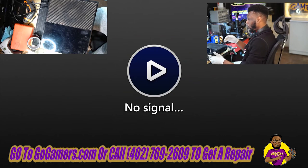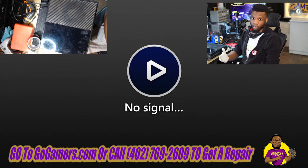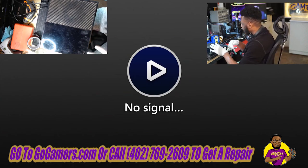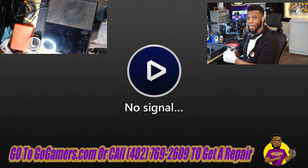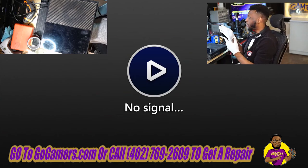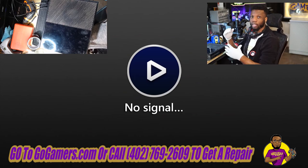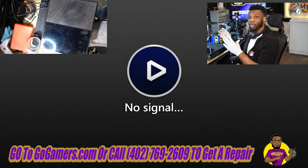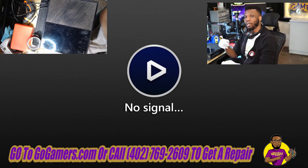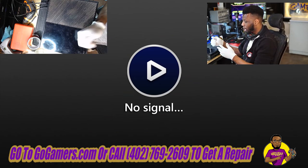The easiest way to diagnose this at home: hold down your sync and eject button — make sure there's no disk inside your console. Hold down the sync and eject button, then just press the power button. You're not going to hold down the power button; continuously hold the sync and eject at the same time. If it doesn't do any beeps and just stays at the no signal screen, nine times out of ten that's going to be your hard drive. If you do hear beeps — you hear the original power-up noise and then another power-up noise — and it doesn't show anything on the screen or go into safe mode, then more than likely it's either the south bridge or EMI filters. But I repair these things all day long and to be honest it's always a hard drive.